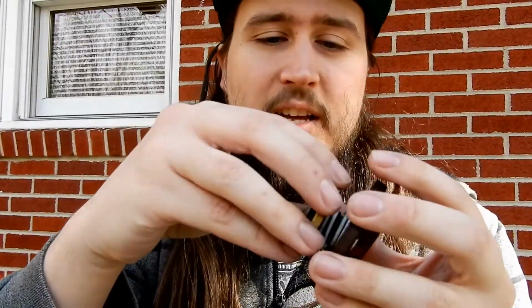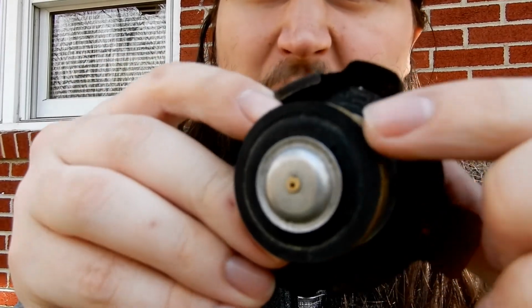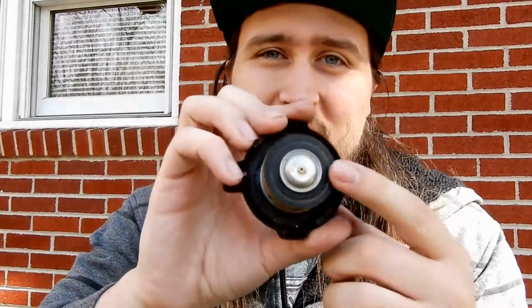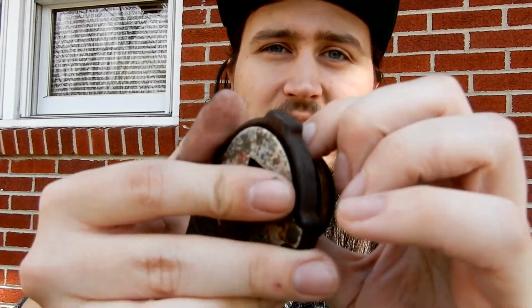And then we also needed a new radiator cap. And we needed that because, let me see if I can get this off. I can't even get this off. But if you look at it from here, you can kind of see that it has like an edge to it here. The new one does not have that. Well, I can't show you the new one because it's already on the radiator. Just believe me that these are what was causing the leak. The kind of rubber gaskets, I guess I'll call them. These were what was causing it to leak.